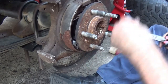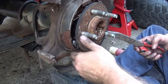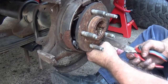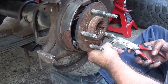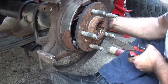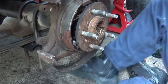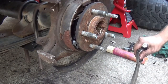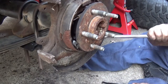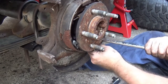Then we take our springs. You guys see a little nail right down the side here with those clips. Take your shoe, wedge it back this way because I want to get to this side over here and get it first. Push in on the clip — that nail wants to walk back a little bit, give me just a second.